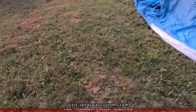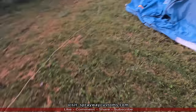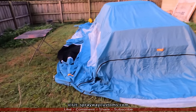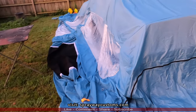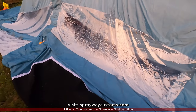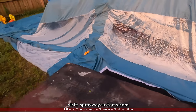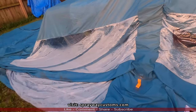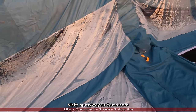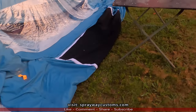Day. Well, y'all probably won't believe this, but I actually didn't paint yesterday. It had got so hot, you can see I collapsed the inflatable booth on top of the car. I had prepped up everything, did all the masking, but it had got so hot, the sun was beaming down through the openings and heating up the metal. It was scorching hot, so I decided to hold off until first thing this morning.